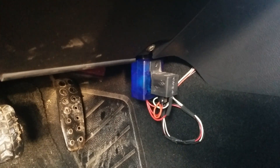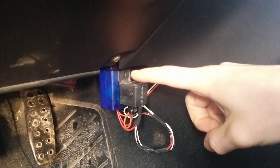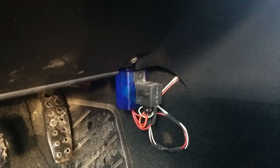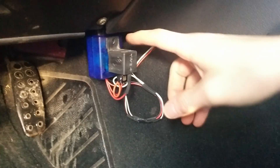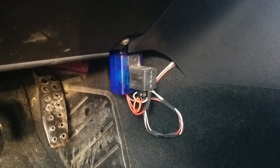It works with a Bluetooth adapter — an ELM327 adapter — that plugs into the OBD2 port down here. Most people use these little adapters on their phones via Bluetooth to run apps like Torque. I modified this one to be hardwired to the Arduino. It's also got a little relay on here for turning it on and off, so it's only on when the car's on and off when the car's off.